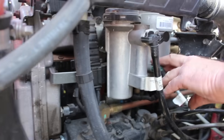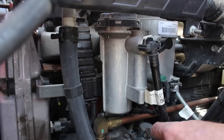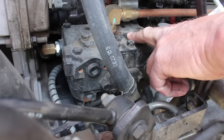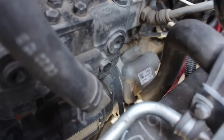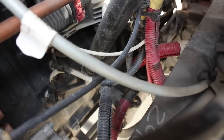Moving inside the engine: my fuel filters and containers are securely mounted, not cracked, bent, or broken — my fuel lines show no leaks. My air compressor is securely mounted, not cracked, bent, or broken — I hear no audible leaks, and it is gear driven. Directly below the air compressor is the power steering pump — securely mounted, not cracked, bent, or broken. Behind that is the starter — securely mounted, not cracked, bent, or broken — with wiring showing no signs of cut wires.